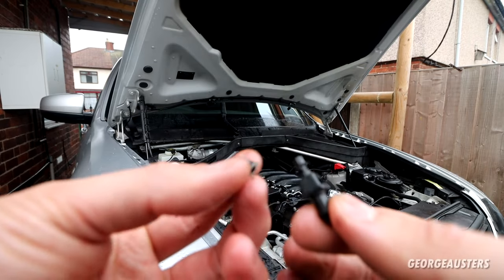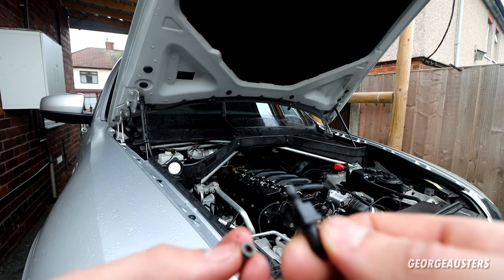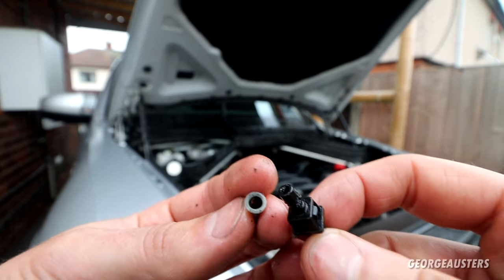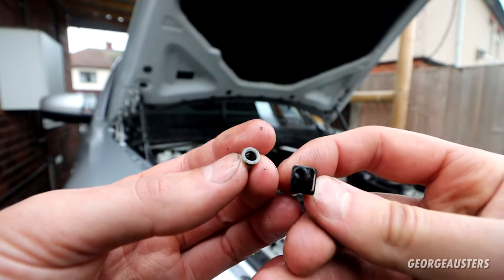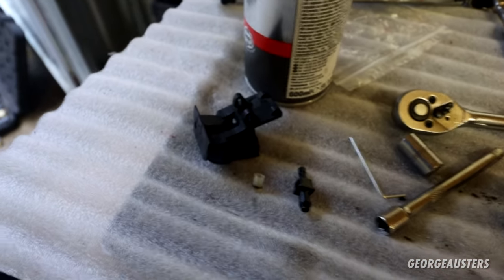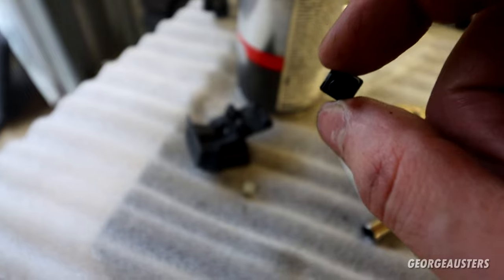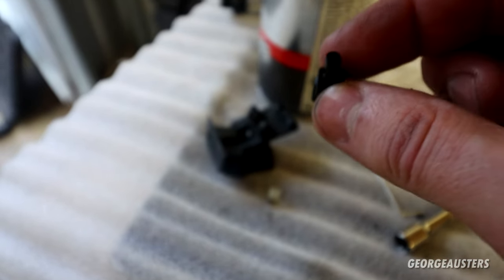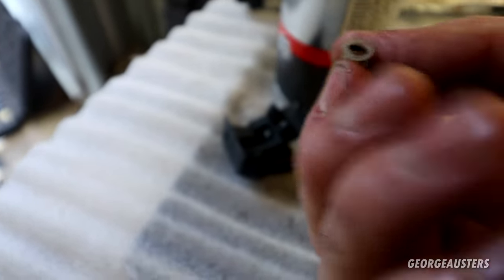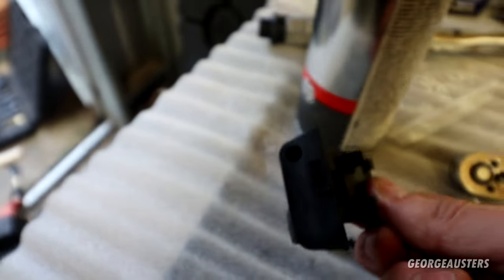I'm beginning cleaning this piece here. This is not a filter — this is just a piece of rubber to hold this in place. But it is completely blocked up. You can see why fluid is not getting through there. I've gone as far as humanly possible — this part is now nice and clean. I've blown it through with compressed air and cleaned it out with brake cleaner. There's no dirt left in this. This little piece of rubber is now nice and clean as well, and I've also blown through the jet itself with compressed air, so it should now be nice and clean.